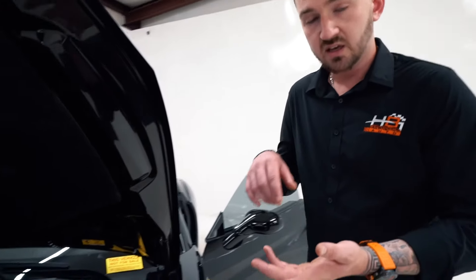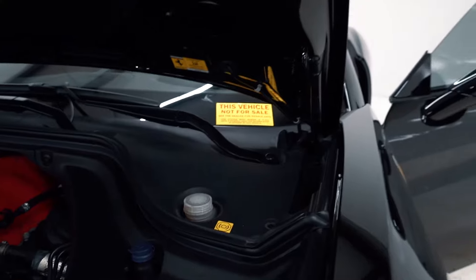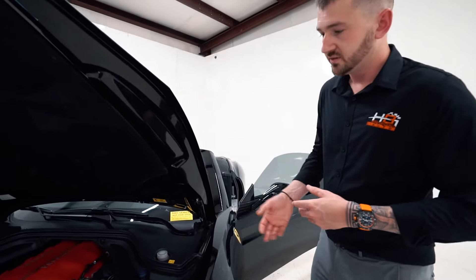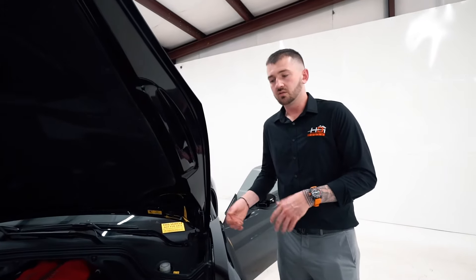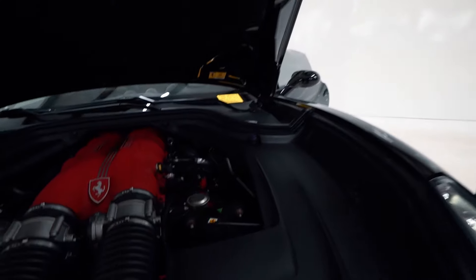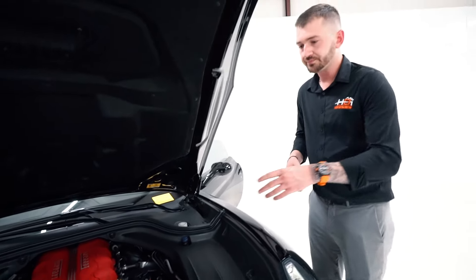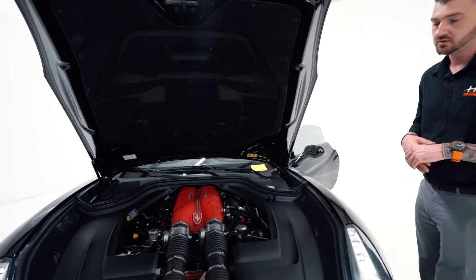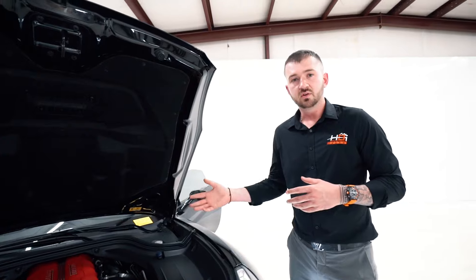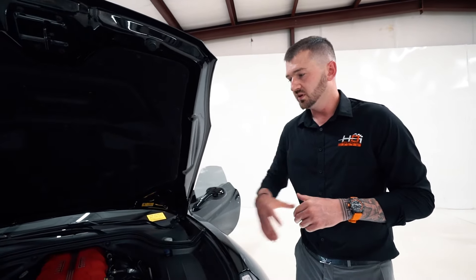Over 20,000 miles, brake fluid becomes hygroscopic — it builds up moisture, which becomes acidic and can eat up brake lines from the inside out, damage the ABS seals, and cause all kinds of havoc to your brake system. It's cheap preventative maintenance — do it every two years and it will save you a lot of trouble. Power steering fluid: we recommend every two years or 15,000 miles. Done correctly it does help prevent some pump leaks, but generally that pump will eventually fail regardless. Coolant flush: recommended every three years or 30,000 miles because the coolant becomes erosive over time, corroding coolant passages and causing hot spots in the cylinders and cylinder heads.